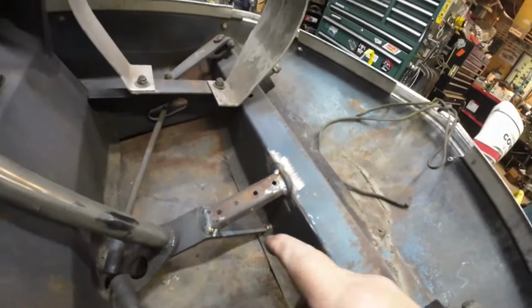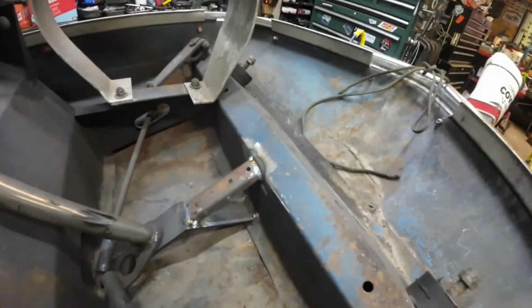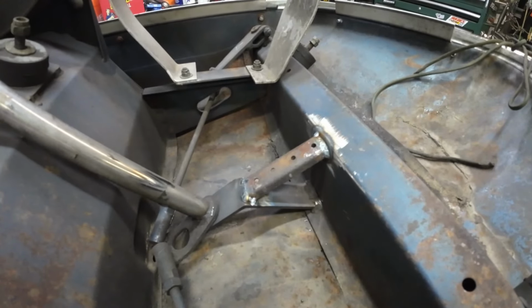All right, there's a steering brace that you should do on a Colt. It's almost mandatory. If you have the engine out, you should drag your welder out and do this. So right here, you can see it's an old piece of a cleat, but we made a nice triangle out of that, and it's going to really fight that steering bracket from bending. So if you got a Colt, give that a consideration.